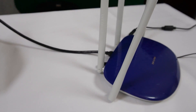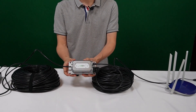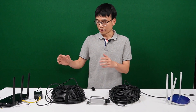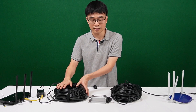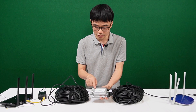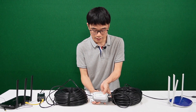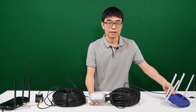It's quite easy. You just need a PoE extender plus a PoE injector. The PoE injector sends power through the CAT6 Ethernet cable from the first router to reach the PoE extender. You can see the first LAN port is flashing, which means it's getting power, and the second LAN port is also on, meaning it's communicating with the second router.